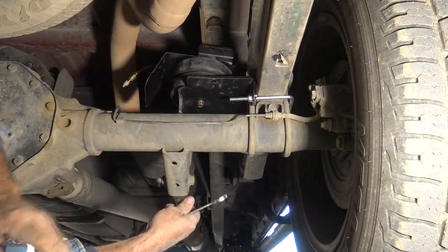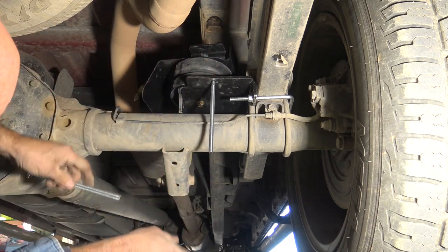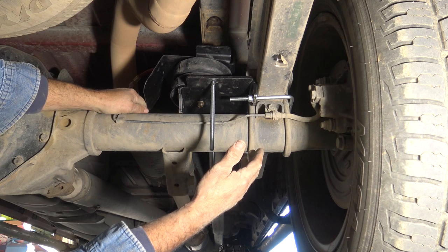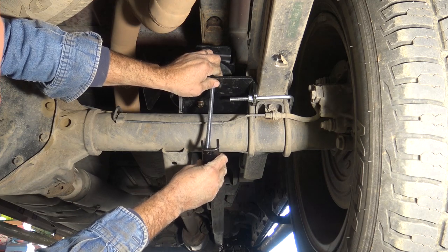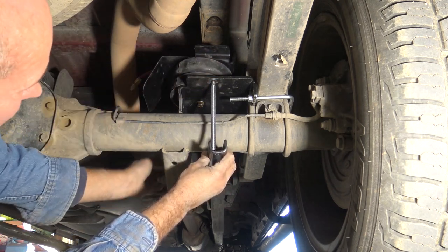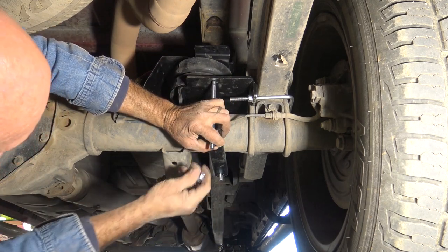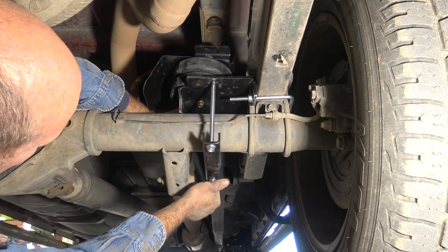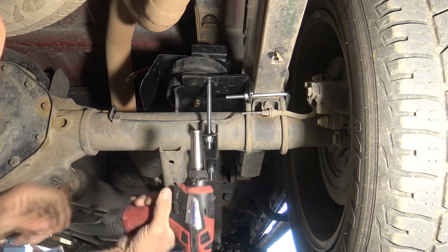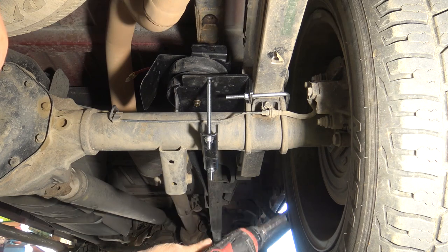We're going to go ahead and get these snugged down. This is tight but not overly tight. Next thing I'm going to do is drop in the carriage bolts — drop these down, and you're going to find everything is super duper long. My guess is that that's just in case there's a lift kit on the back, that gives you a little extra room. I'll probably be putting a two inch lift kit on this truck in the next six months. So that's actually a good thing to have a little extra bolt. I'm using a deep well socket and my little AC Delco 3/8 battery unit — these are very good, I've used and abused this for two years and the battery is still good.